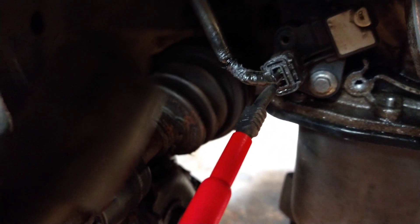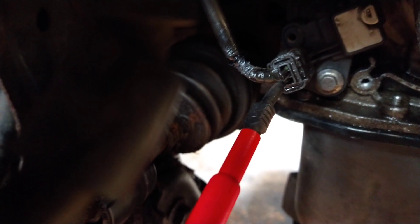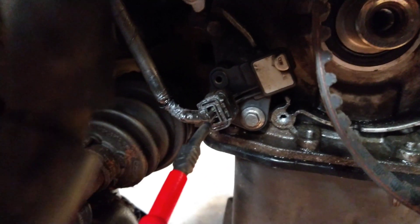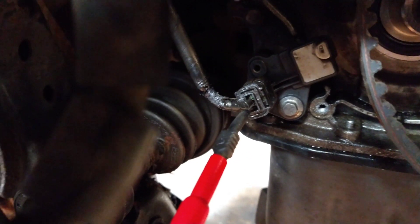Here's a shot of where we were back-probing the crank sensor, on the timing belt end of the car. The timing belt has now been removed so the pulley could be taken off and checked. And it is indeed faulty, so there's going to be a new pulley to start this car.